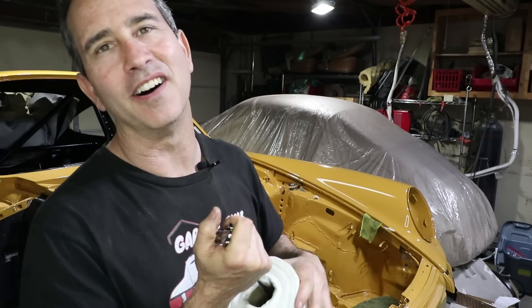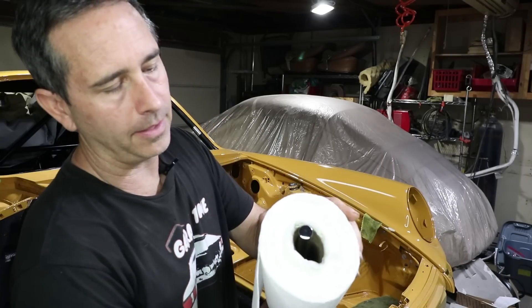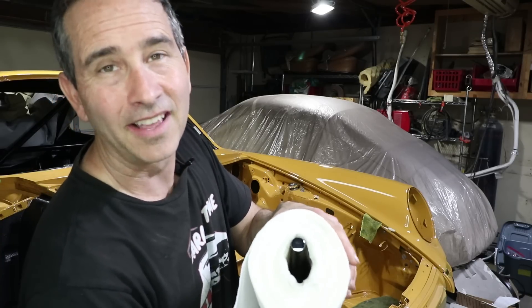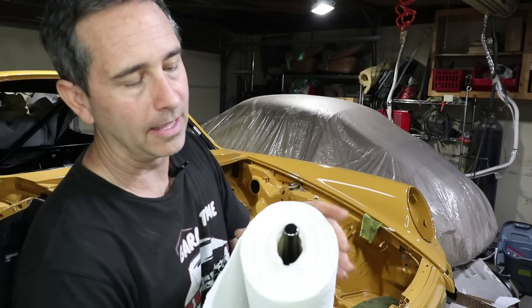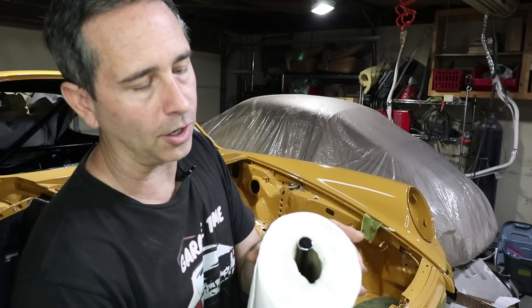I got this roll of paper towels in my breaker bar. What I measured was ideal conditions — just moving the arm up and down. Well, the suspension arm also has to handle all the braking loads and the cornering loads. When you're taking a corner, the load on the bushings is now taking a side load, and you can see how it deflects — the paper towels going like this. So now the bushing has to control the suspension arm and pivot at the same time. When it's being compressed and spinning, you're going to get a totally different spring rate than when I just lifted with my arms. Now I'm off my soapbox — let's get these bushings in the car and see how smooth they are.